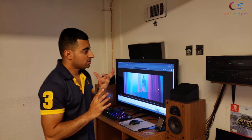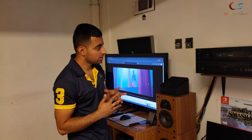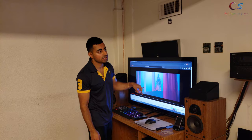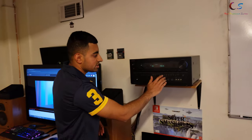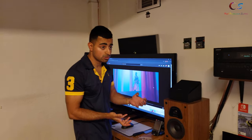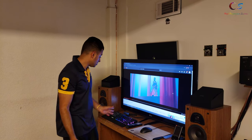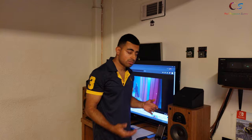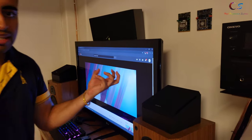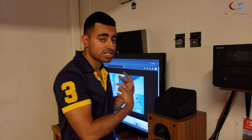One of the nice things about having these extra speakers is, even if you don't play content that's Dolby Atmos certified, you can still get the effect — kind of. For example, this is a YouTube video, and I've gone ahead and set my receiver to Dolby Surround, and what this will do is take in the signal — which is two channels — and convert it to a signal where all the speakers are working. If I play music, if you get closer, this speaker is making an effect — it's only playing parts of the audio to create a sound effect.